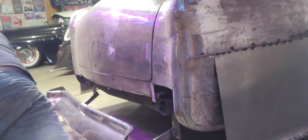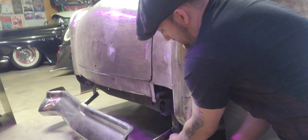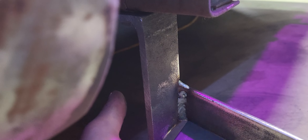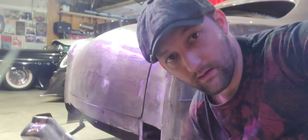So we're going to put these little triangles right here, and that's going to give it a lot of support. I'm going to grind this back some and put this just like so. It's a nice finished piece and it gives it more structural integrity. I want this bumper to be as strong as she can be, so that's why I'm doing that. Plus we don't want it to rumble while we're driving, so these are going to go in.